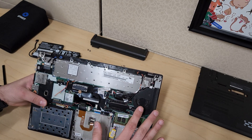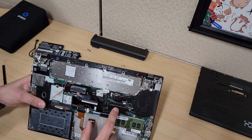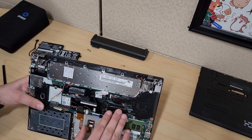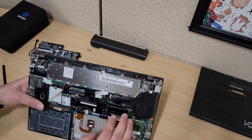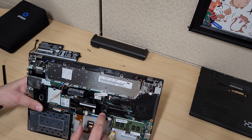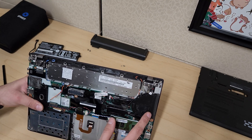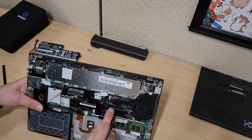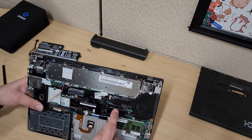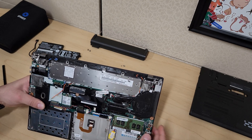If you have overheating issues and need to reapply thermal paste, your heat sink is right here. I'm not going to cover this in this video, but if it's requested I'll do that in a different video. The heat sink is held down by four screws, and it looks like the fan module most likely comes out with it. You just clean the old thermal paste with a cotton swab and rubbing alcohol, then apply a dash of thermal paste onto the CPU — or heat sink, it really varies.